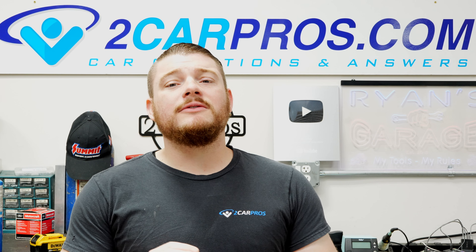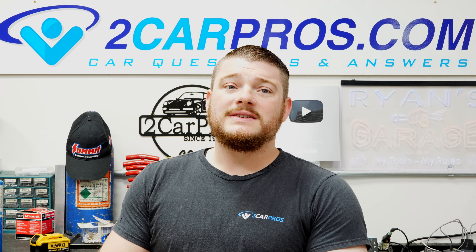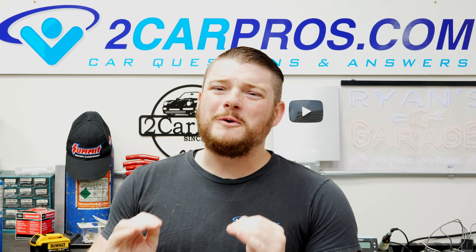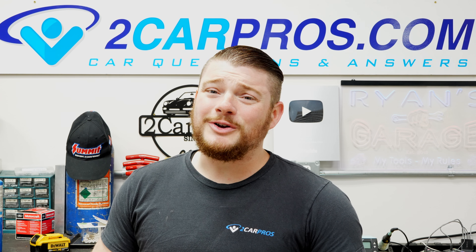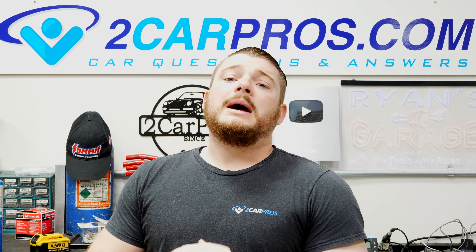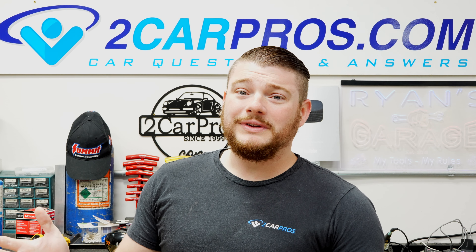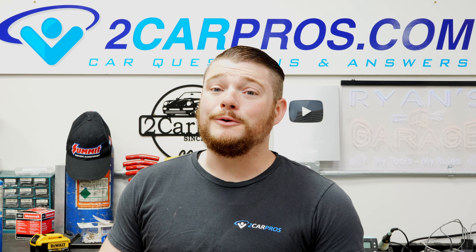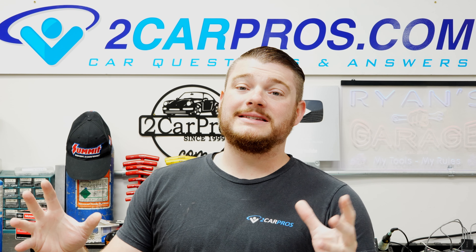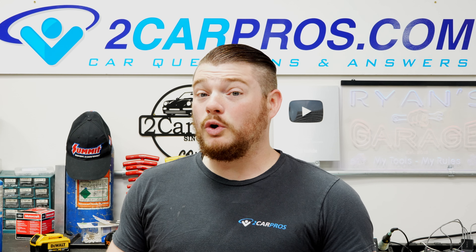That is how to use a little R134A to top off your AC system — this is very easy and you could do this in a parking lot. The only thing I want to say is don't put too much in. I see this all the time on our site, 2carpros.com, where you can ask a question for absolutely free. People put in too much refrigerant and the low side on a cool day reads 60 PSI — that's way too much. The pressures become too great and the AC system can't work efficiently, or even at all.